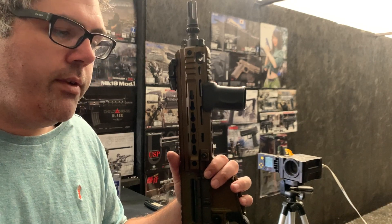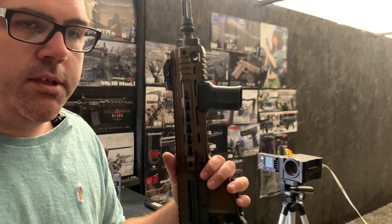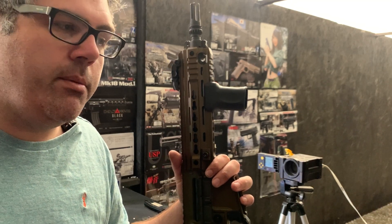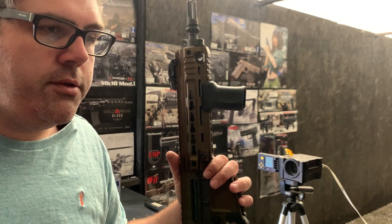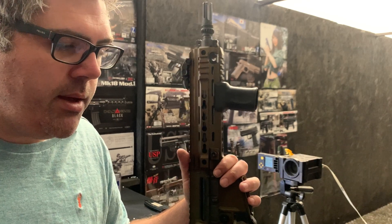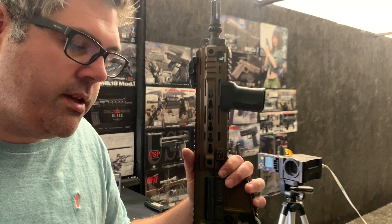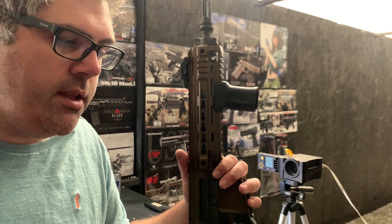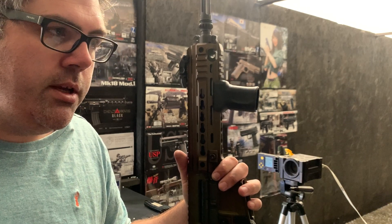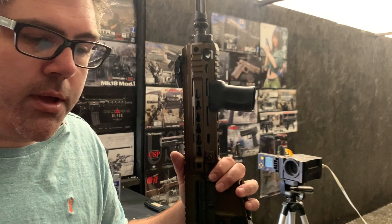We combined two gears from the Prometheus wide ratio 18:1 set, because the bearing failure caused some damage to those gears and actually to the shell itself. We ended up polishing the shell quite a lot so it didn't look like somebody chewed it — though we do that prep work to the gearbox anyway. We got them paired up with the SHS DSG sector gear that was already in there, and did all the shimming on that.